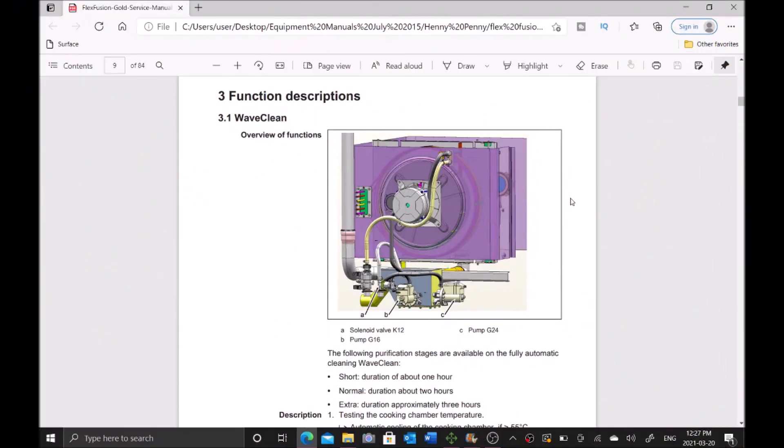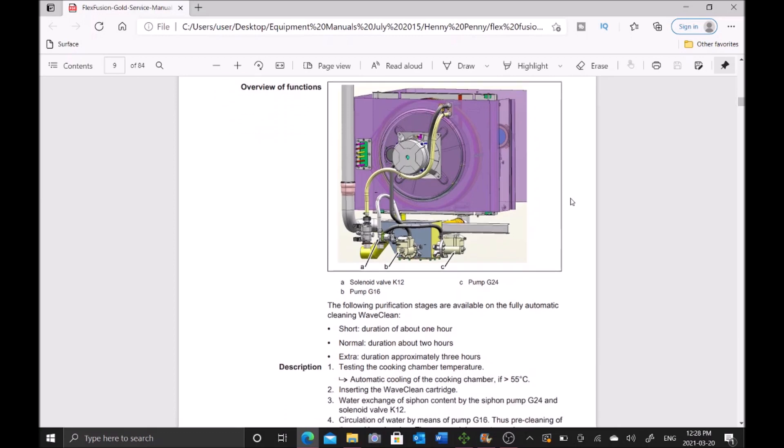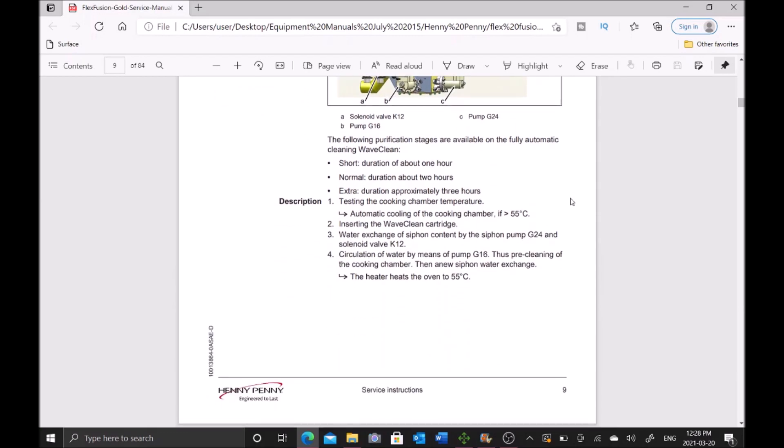It's a self-cleaning oven so we should not be having any of these issues. This oven should be very clean and very shiny. I've pulled up the service manual here. We're going to go through all the components and what they do. There is a clean jet test — I only use that if I'm chasing an error code or if I want to see if there's a water leak during the cleaning cycle through the door gasket. It's only a 30-minute test but I find you can't really pinpoint the issues through that test. The relay mode is way more reliable. Let's quickly go through the sequence and what everything does.